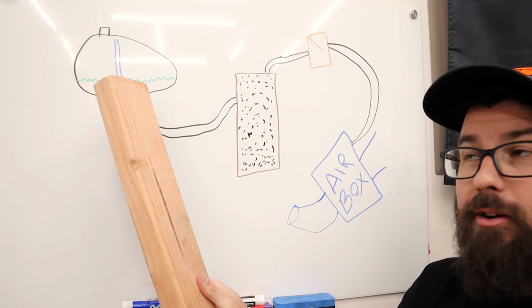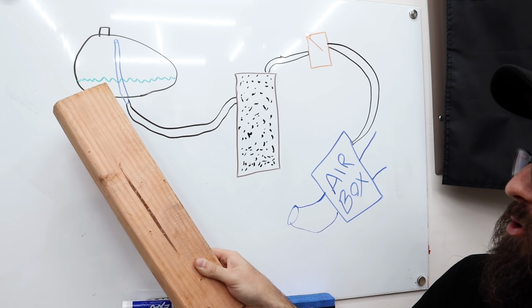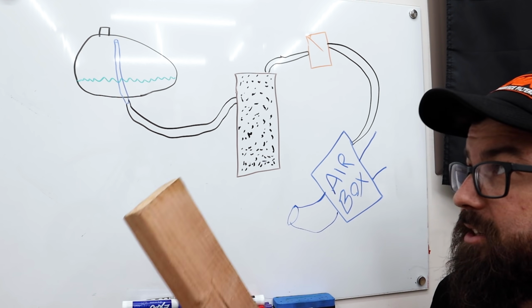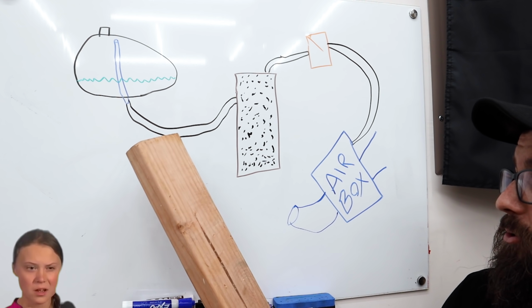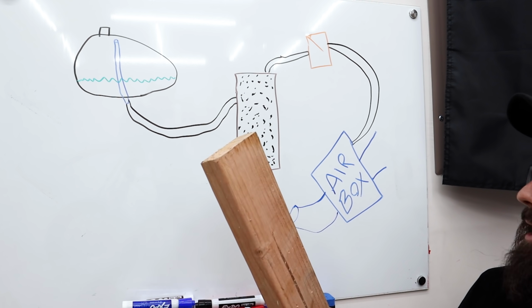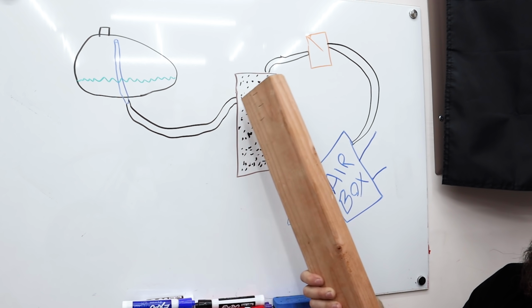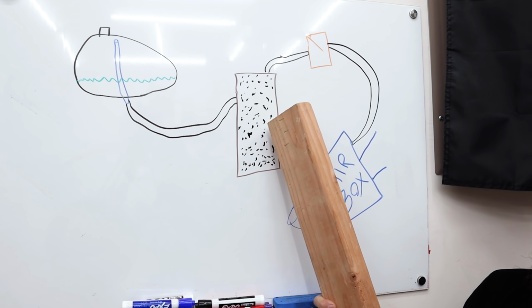In our fuel tank up here, we've got some gas, and we need to make sure that we're venting this. It also helps if you overfill the bike. Now, at some point in time in the world, we would just vent this under the frame of the bike. But no longer those days. I'm guessing the EPA and other environmental agencies around the world don't really like that. So instead, they have us put one of these on there. A can of charcoal. The idea is if any little bits of gas, maybe from overfilling or sloshing around, gets in here and works its way down to the charcoal canister, it'll sit in here and sort of dry out, if you will, and turn into fumes.